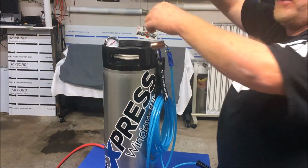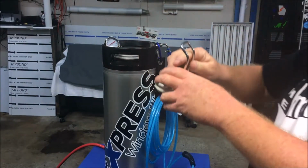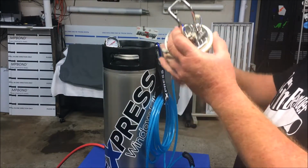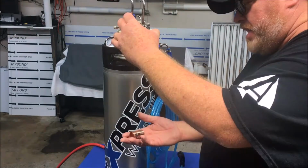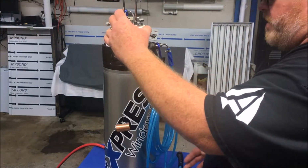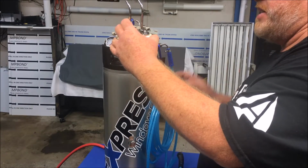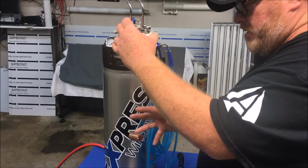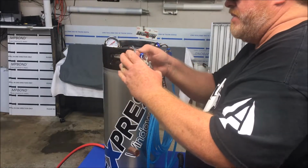Now this right here, we call it the back tube. What it does, any inert stuff that's in the water, contaminants or whatever, this copper is like an absorber. Anything that's in the water will stick to this before it will stick to stainless steel. So anything that's in there that builds up or whatever is going to collect on this. It keeps that stuff out of your water, keeps your water cleaner longer.